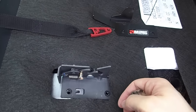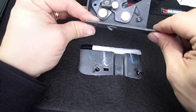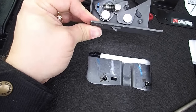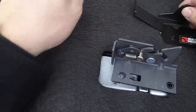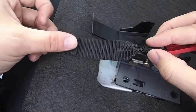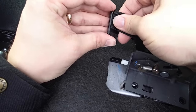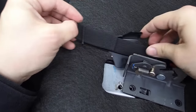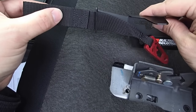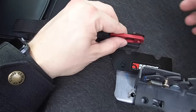I've got both of those out, setting them aside. We've got the latch — notice that the latch has a tab here, and that tab slips into a square feature in the seat. Just take note of that. Now we'll start by assembling this. I prefer to have the seam facing up, which puts it facing back towards the back of the cab. Go ahead and thread that into the support — it's kind of nicely fit so it will keep the strap from falling back through.